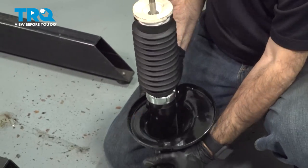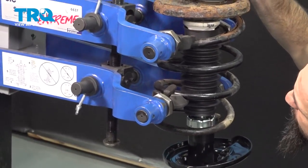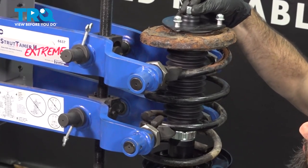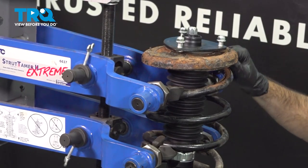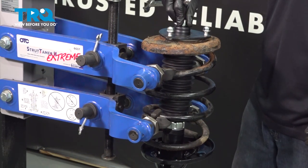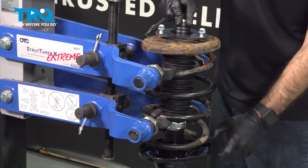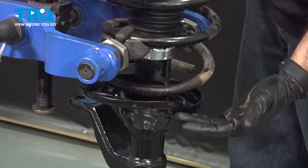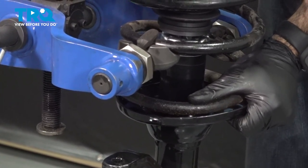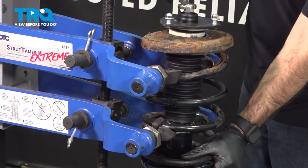Once we have that done, we're ready to install it into our spring. We're going to load it into the spring from the bottom up, put our nut in our other hand, raise this through the top mounting plate, and then thread our nut on to hold it in place. Once we have our nut threaded on a couple of threads, we can release — the unit is together and now we can tighten it down. With an 18mm wrench, we're going to snug this top bolt up before we release tension on our spring. We'll grab the bottom of our strut and the spring coil — there's a spot where the bottom coil meets up with a little step in the bottom plate, and that half coil is going to go into this bottom step.